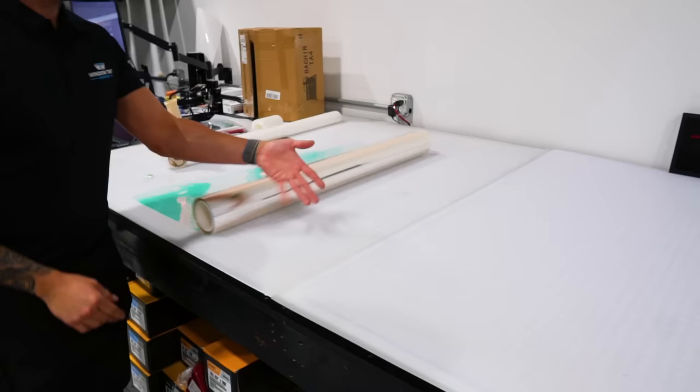Grab our piece. We have the release liner detached, but water between the release liner and the film. Release the release liner, stick it to the roll, and reverse roll it. On she go. Work around the mirror and the cameras, making sure the bottom is making contact with the window. You don't want it to be touching the dashboard.